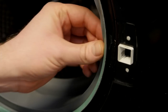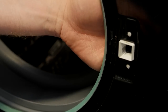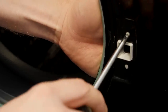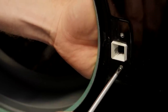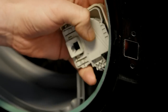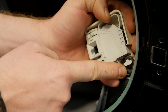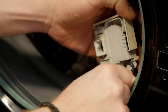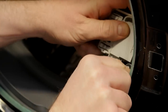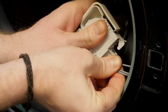With the door seal released I can now reach in and grab hold of the door lock. Using a screwdriver I can just push in these pips one at a time and then take the lock out. Here we can see the electrical connection and also the emergency door release. Just turn the lock until the door release comes off, and then I can disconnect the electrical connections.